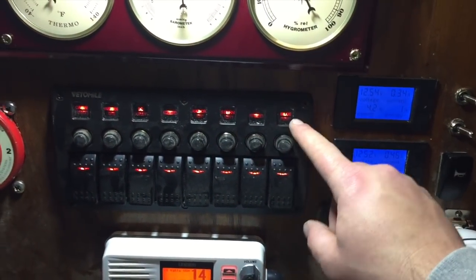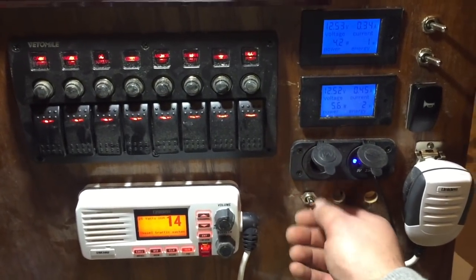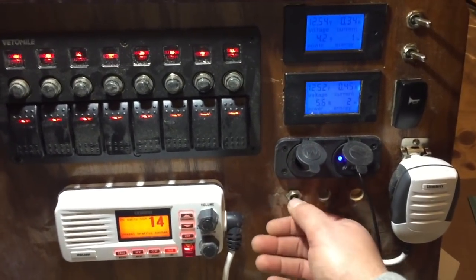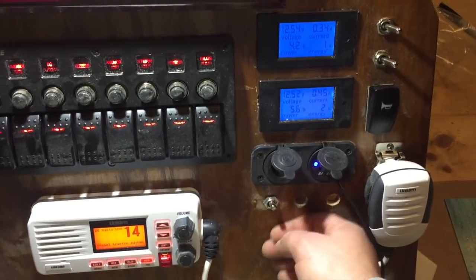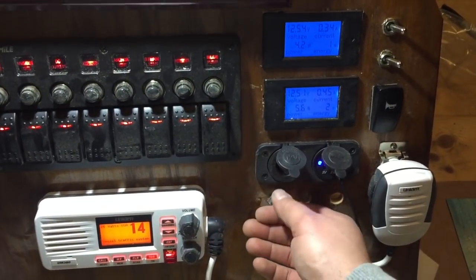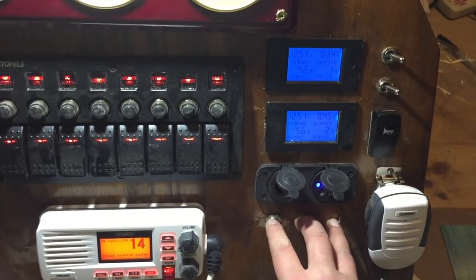And again, that's going to be three separate bilge pumps, which are controlled down here manually. So if you want to turn on one pump individually or all of them at once, you can do that here. They also have a float switch in case water comes in unbeknownst and gets to a certain level, and the float switch can kick on automatically. But if you just want to turn them on manually yourself, you have three switches for each of the three separate bilge pumps here.